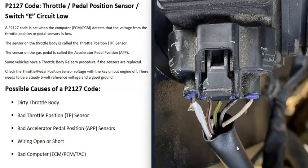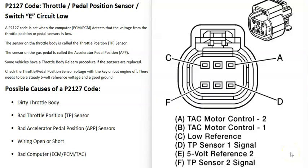The next possible cause is a wiring problem — an open, a short, or a bad connection at one of the plugs. You can find wiring schematics for your particular vehicle; quite often you can find them for free using Google Images, and there are also some good paid options linked in the description. It's very common for these circuits to have a five-volt reference voltage, so you'd want to test the circuit, confirm you have a good ground, and verify the voltage going to it is correct.